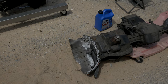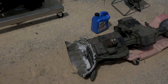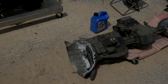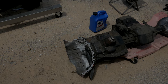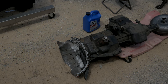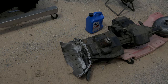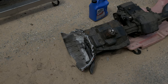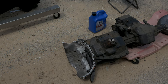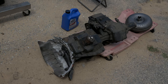Let me talk about what occurred taking my SM465 off my 5.3 LS engine. As you can see I did some damage taking it apart, because the input shaft of the SM465 was fused not only to the pilot bearing but also to the clutch. That was my issue with that transmission all along. I press-fit it together — it wasn't quite loose going together and I had to thread some bolts through, which usually isn't the right answer since if you have to press it together something's probably not aligned right.